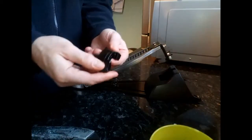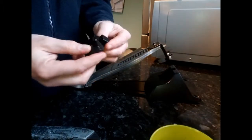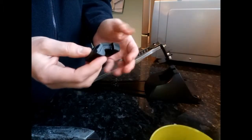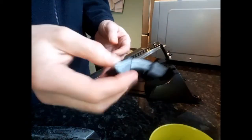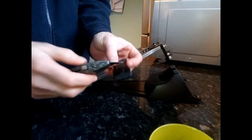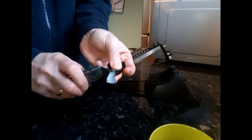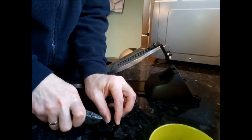So what you want to do is make sure it stays pliable even when it starts to get a bit harder again, because after maybe about 2 months it will start to harden again, but you can just do this process again and make it soft and pliable by putting it in hot water. But in order for it still to be able to bend, what we need to do is cut some slices into the rubber. So if we take a Stanley blade, without cutting your fingers, obviously you don't want to cut all the way through, you want to cut part of the way down.